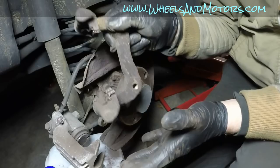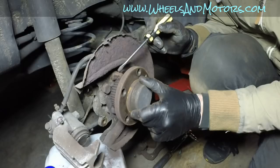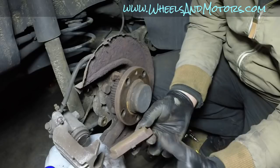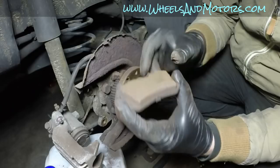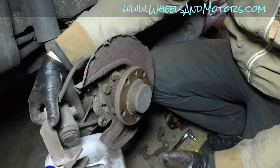Note that the protruding sensor is your ABS wheel speed sensor - be careful around it. Now let's go back to the caliper. When replacing old brake pads, the old ones will be much thinner than the new ones. The caliper piston is pushed out to match the old pad thickness, so to fit new thicker pads you need to push the piston back in. Unlike front calipers where you just push it in, this rear piston needs to be screwed in clockwise.